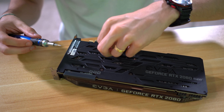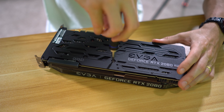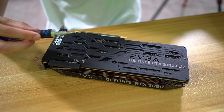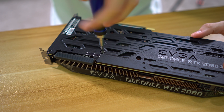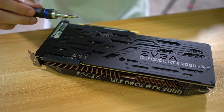Now it's time to take this apart. This will introduce slight variance because there will be tiny differences in how the cooler is torqued down, but I'll try to be as consistent as possible. We should expect the Carbonaut pad to cool as efficiently as the stock thermal paste on this card.